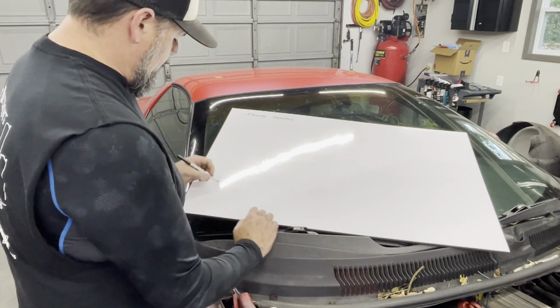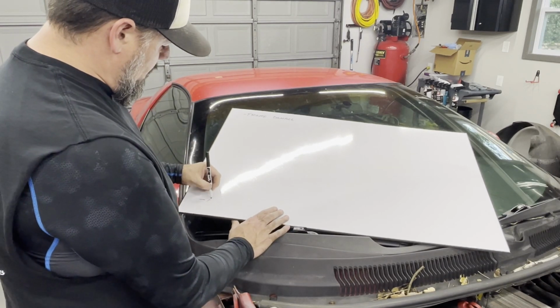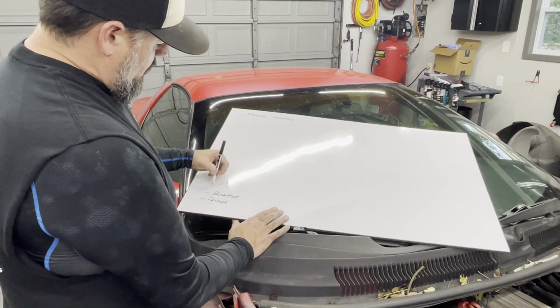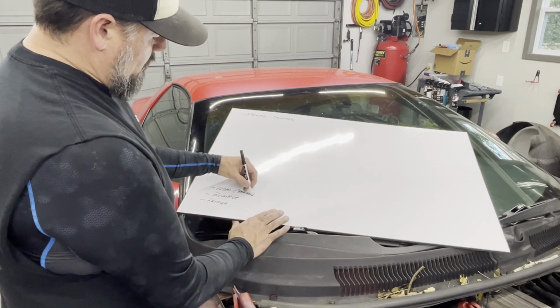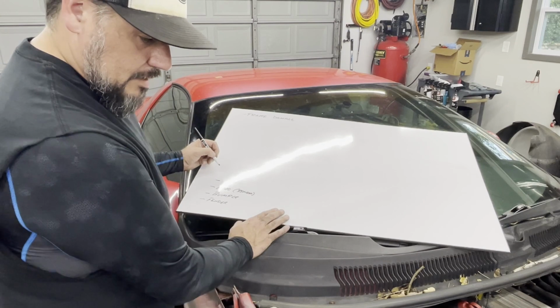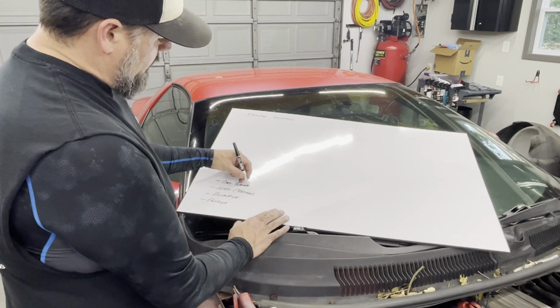So after the frame damage, I'm gonna start down here with some of the outside body parts. We've got the fender, bumper, and hood, hopefully as a repair. I don't want to buy a new hood. It's just a small little nick out of it. That's probably doable. Then the rest of it, we've got the core support, probably cut out and replaced.